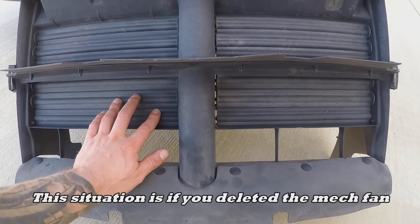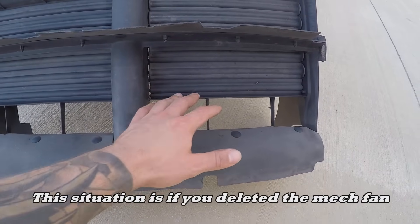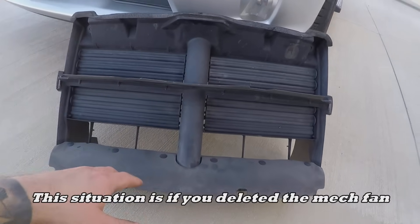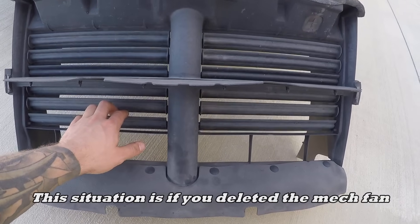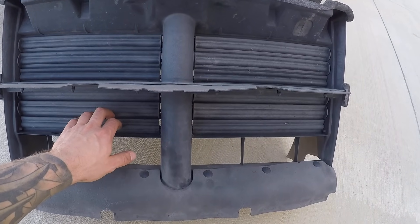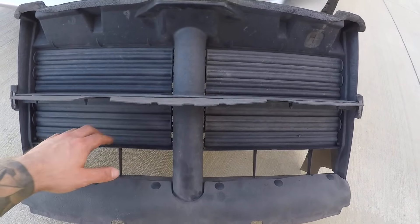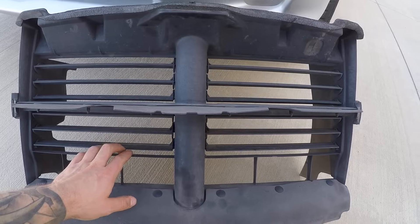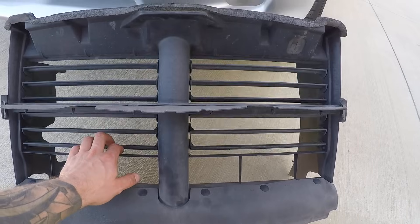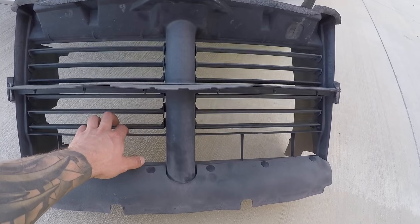On the freeway, the AGS stays closed and you're not getting much airflow except through the small opening. Your fan ends up constantly cycling on and off even on the freeway, when you could easily have had enough airflow with the shutters open. With Diablo Sport tuners, you can't tune when you want these to open — you can only control fan operation. You can disable the AGS completely, but you can't actually tune when they open and close. That's buried in the programming and Diablo Sport doesn't have control over it.